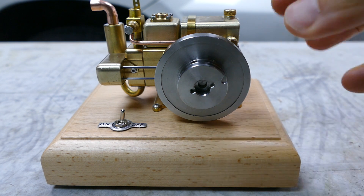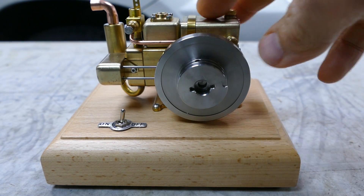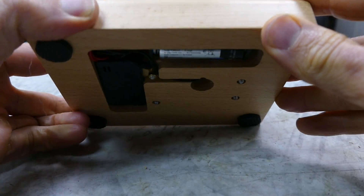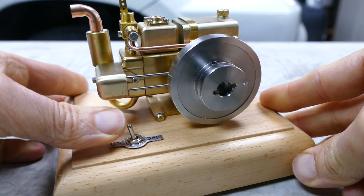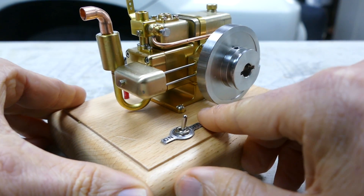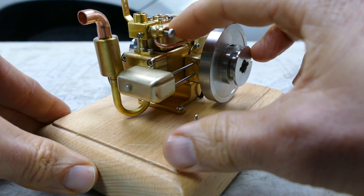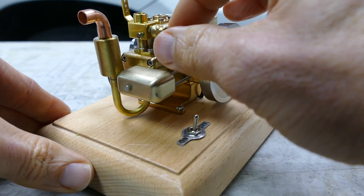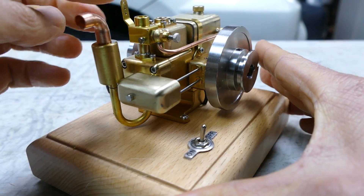I'd love to be able to put this in a car and see if that would run — I think that would be really cool. If you're interested in this little engine, the link is down below. Now, if you flip it upside down, that is where you've got the electronics. It takes one AA battery for the ignition system, for the spark plug. There's an on/off switch just here. You've got two flywheels to help with momentum at low RPMs. You use pushrods for your valves because you have inlet and exhaust valves up under this little cover. Here's your fuel tank, your water jacket, your fuel line to the carburetor. You've got little adjustments here, and this is your main throttle. If I want to put it into a car, I would attach that to a servo.